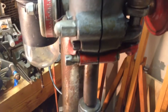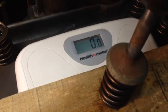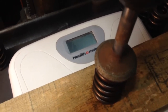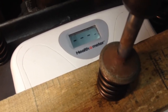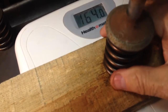So you can compare your springs and find the weak ones. The key here: the scale is on zero, I make sure the spring is centered — there's just a little bit of rotational play in it but no upward movement. Recalibrate the scale, then I'm just pulling down on the drill press, and this one's 164 pounds.